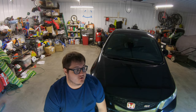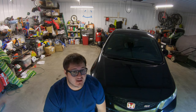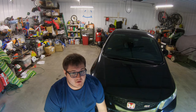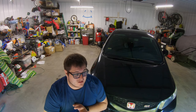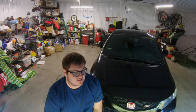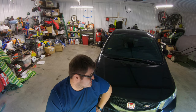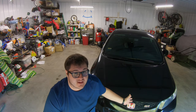I did one base coat, waited about 45 minutes, then the second and third base coats. By the time I got to clear coat it was 8 or 9 o'clock at night. I put one coat of clear down and had to wait over an hour and a half for it to flash, and the second coat wouldn't flash for a long time either. Because it was tacky for so long, I got lots of bugs, dirt, and sand embedded into the paint.